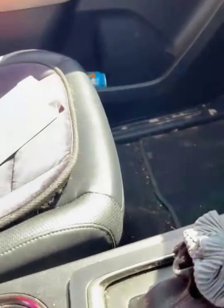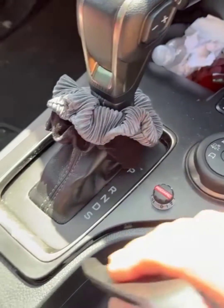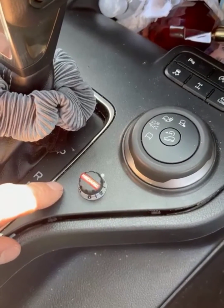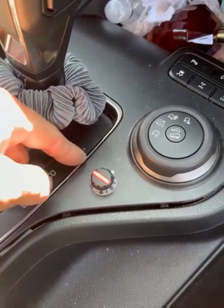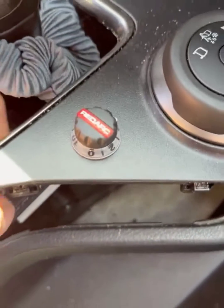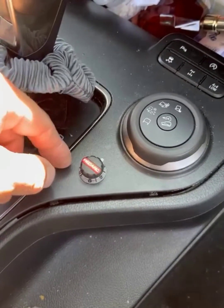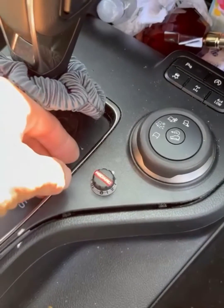It's really easy. Use a little trim tool and pry up this section here — just give it a little tease. There are clips all the way around and it will click off, then you can lift that section up to make sure you've got clearance. Basically just get a clear spot between your off-road four-wheel drive system dial and your shifter and drill a pilot hole — 3mm. Make sure you clear everything down there, then work your way up from 3mm to 6mm to 8mm, then to 10mm as your final drill bit. The reason you step it up is so you don't crack or fracture the trim.